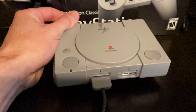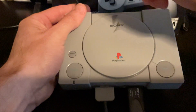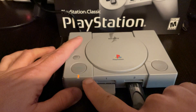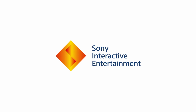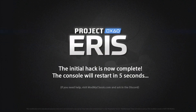Don't plug in the PlayStation Classic or power it on just yet — we've got some extra steps to consider. Your PlayStation Classic should have the USB drive plugged into the rightmost front port, with the system not yet plugged into power. Go ahead and plug in power to the back of the system now and wait about five seconds for the power indicator light to turn amber. Once the light turns amber, press the power button to turn on the system, which will turn the power light green. I recommend this process for every boot-up moving forward. When the system boots, you'll see the Sony Interactive Entertainment splash screen, then the Project Eris logo. It will create a full backup of your internal firmware onto your USB drive, then install key components of Project Eris. Once done, you'll hear a series of chimes, see a completion splash screen, and your system will automatically power down in five seconds.